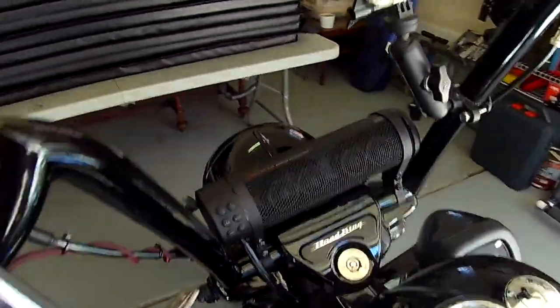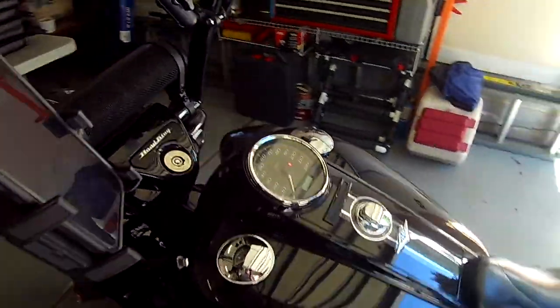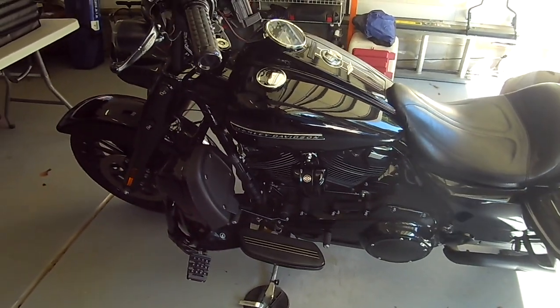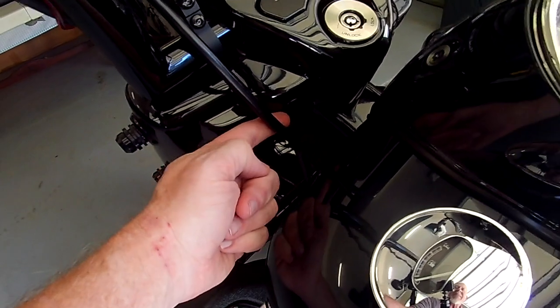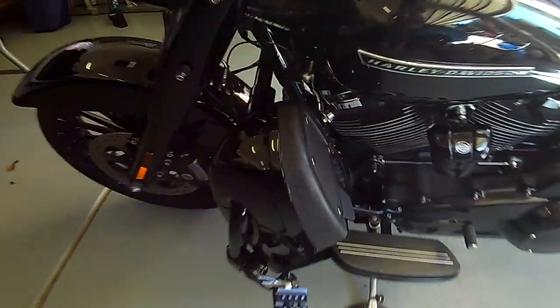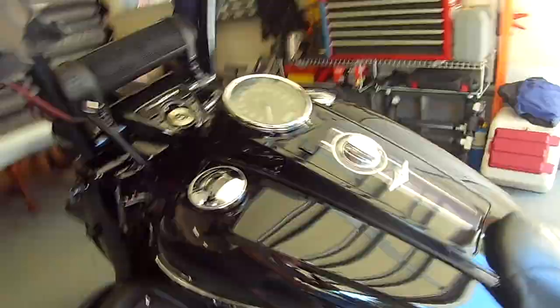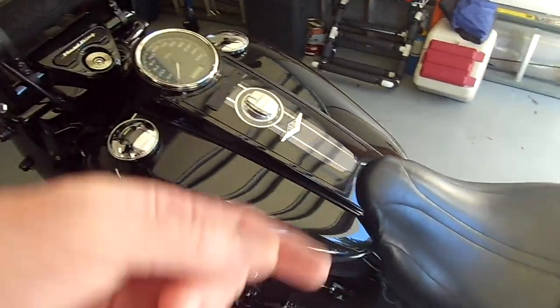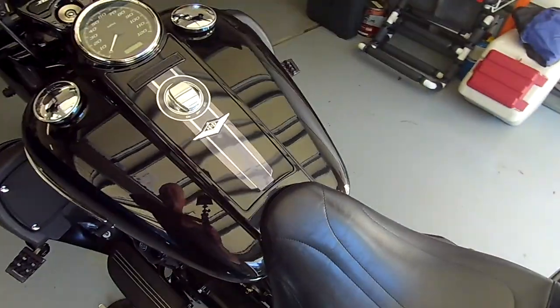Let's talk about how this thing mounts. The hardest part about mounting this speaker on a Harley-Davidson Road King, Road King Special, or Heritage is that you have to run this cable down the backbone of the bike, which means you're going to have to pull the tank. Pulling the tank is not that big a deal — there are tons of YouTube videos showing how to do it. On this bike there's a bolt here, a matching bolt on the other side, and two bolts under the cover. Then you disconnect the fuel line with a quick disconnect, pull the tank off, set it to the side, and run that cable down. You've got a wire to connect to the battery positive, a wire for battery ground, and a control wire.